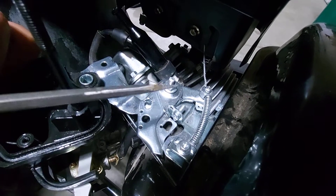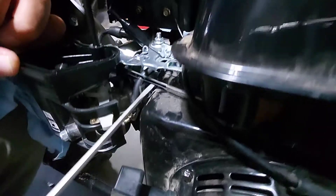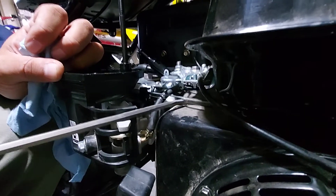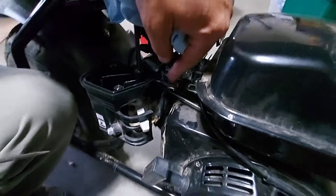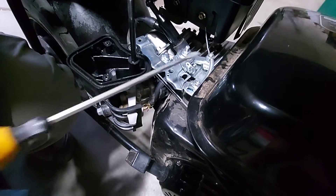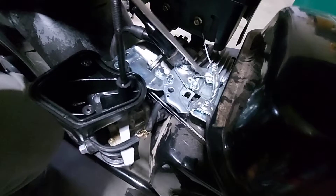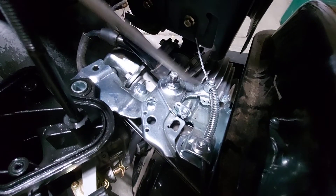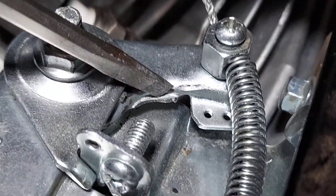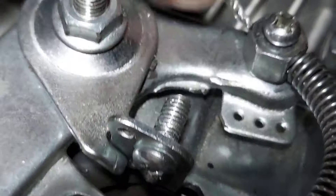There's a whole bunch of cables you have to be mindful of. Number one is the throttle cable itself and the spring. Number two, if you look down here, there's an arm — there's no spring action to it, but obviously this one is a spring. This is what keeps the throttle coming back — so when you let off on the handlebar, it snaps back. You're going to take this apart. It's just making these two things — taking these two out and then unhooking these. Remember where they go, take a picture. On the old one, right here there is a metal tab that's straight up — that's what hits the screw, that's what makes it stop.